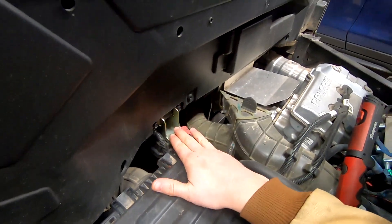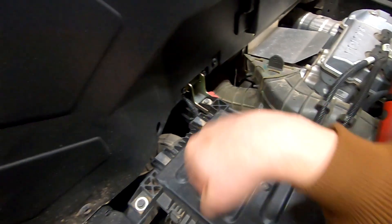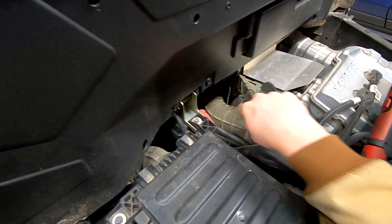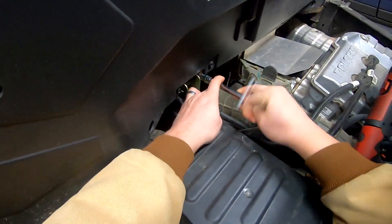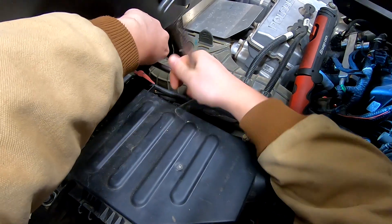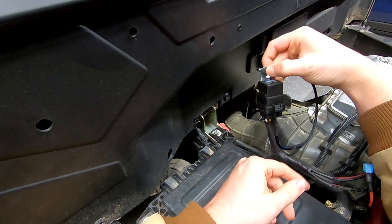Right here on the bed, this is just coming about straight down from the rear window. There is this mount here — the right bolt that's holding this mount in is what we are going to be pulling off to then secure our relay and ground. The socket needed to take this bolt off is a 10 millimeter. Once that's off, we can take our relay and our ground connector, which is the shortest one, put them right on top of each other, then this bolt can be replaced right back where it was.